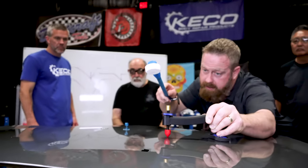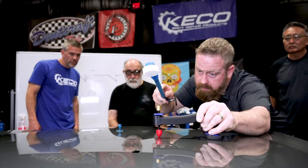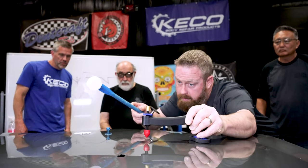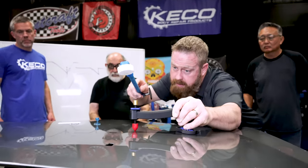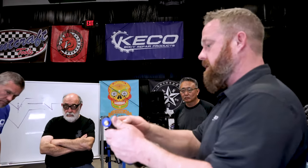I'm a little bit higher back here now. Tap right there. Right here. Getting down there. On aluminum, tight little high spots. Again, increasing our aggression. This wasn't quite laying it down. I wanted to lay it down. I want to hit harder. Metal to metal with that polished face is a stronger strike.